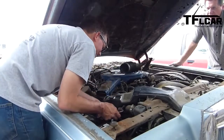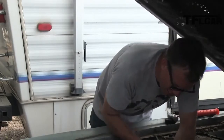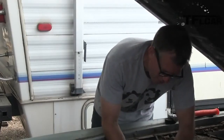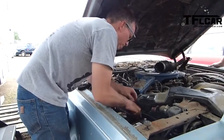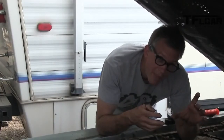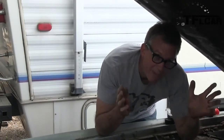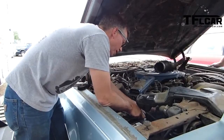a lot of times, in fact, I saw one of the comments, why didn't you change the oil? Well, if you've got an old soot bomb that's got hydrocarbon filled oil and you parked it back in the dawn of time, and it's all sludgy, it does get acidic, and it'll actually bond a main bearing to the crank, and once you crank it over, the babbitt gets ripped off and you've killed the bearing like that. Changing the oil doesn't change that. If it's happened, it happened while it was sitting here. Usually it's in damper climates that sort of thing happens.